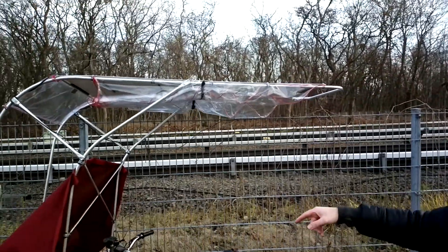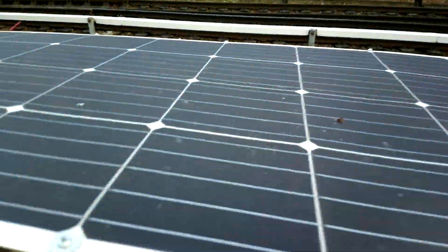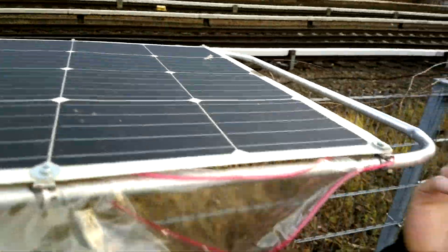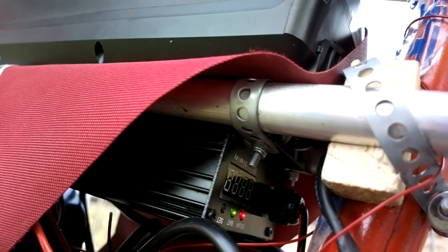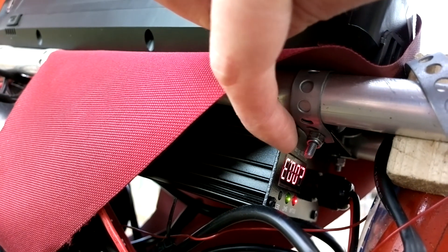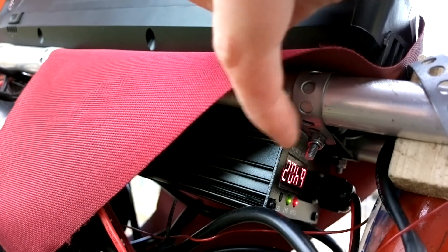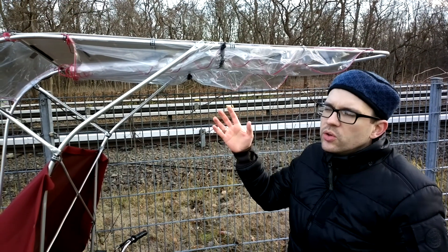The additional feature for this electric bike is this solar roof. You have a 160 watt peak monocrystalline solar panel on top which produces electricity when the sun is shining. The cables run down to a small charge controller hidden away below. Right now it's quite cloudy and it's winter, so the panel voltage is around 19 volts, the current is 0.3 amps, and the battery voltage is 40.1 volts. The charge controller boosts the voltage from the 18 volts the solar panel produces up to the 40-42 volts the battery needs.